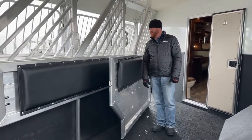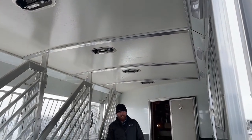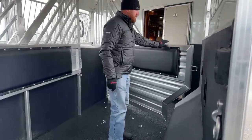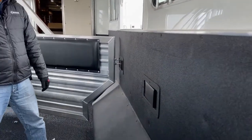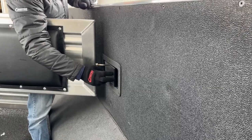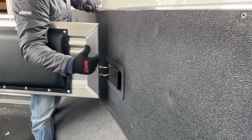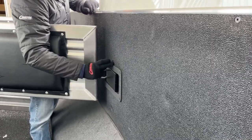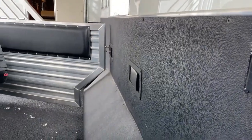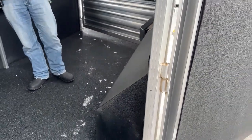You've got two-way roof vents for even more airflow manipulation, kick mats all the way around — Cimarron does a great job of that. The divider latches are real simple: push them shut for safety. They're recessed against the wall with a heavy UHMW plastic paddle, and the metal from the divider hooks into it so there's no metal-to-metal rattle. It's a cast aluminum piece that's powder coated and rounded — everything is tapered, including the fender and the backside of the fender. No sharp 90-degree angles or protruding edges. With 9K axles, the wheel wells are a little bigger, but that's what this size trailer calls for.